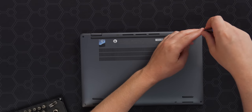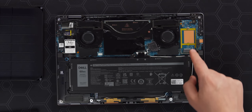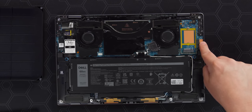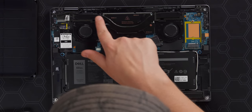Of course, being a business laptop, it has a bunch of things that make it generally safer and more reliable — like if the BIOS has been tampered with or corrupts, it can fix itself, and also chassis intrusion detection. I'm rather surprised they just have straight-up Phillips screws on here. Very simple to get off. We can see where your SIM card would go if you optioned it — a 5G card would plug in right here at a little PCIe header, with a SIM tray slot visible. We also have our 60-watt-hour battery, which netted us seven and a half hours, and two fans with a heat pipe.